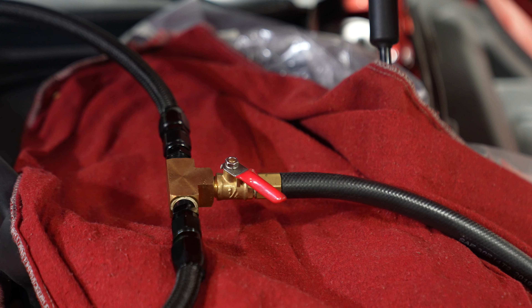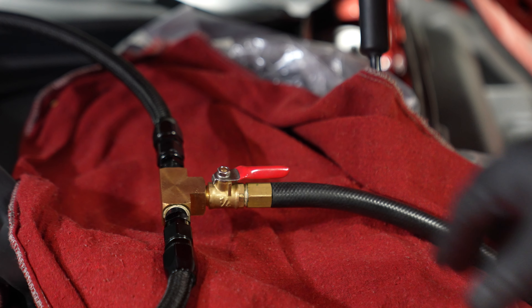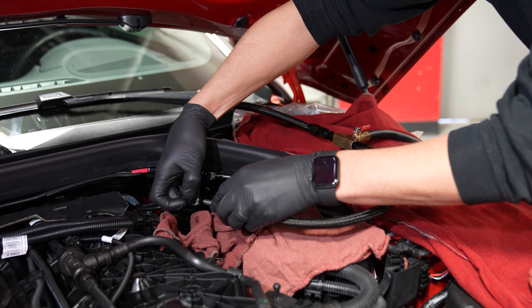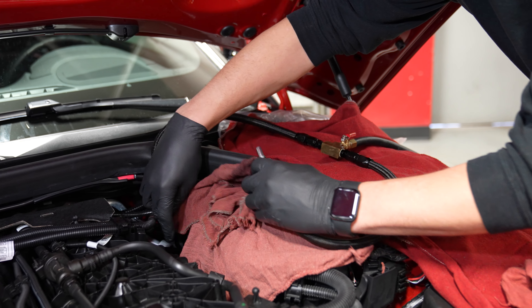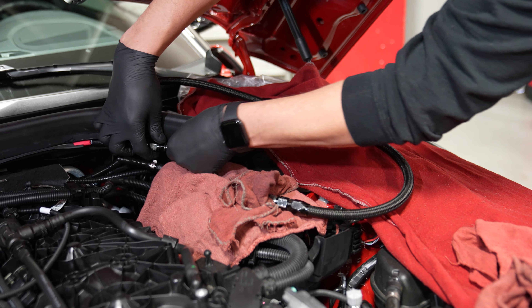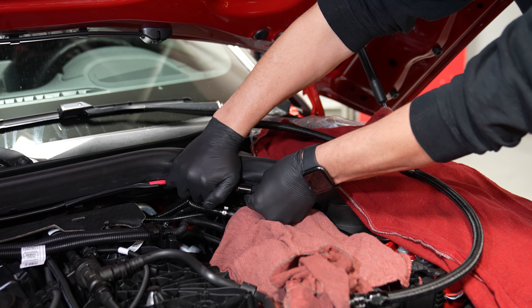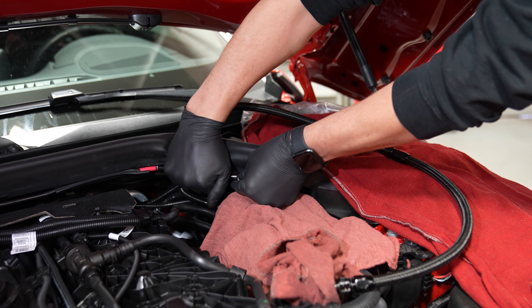With your fuel drained or sampled, you're now ready to remove the bleeder assembly. With the engine off, make sure the drain hose is still placed in the fuel container and go ahead and open the ball valve entirely. This will bleed off the pressure and allow for a pressure-free disconnection, but still be prepared for some fuel to come out. Reverse your steps and reconnect the OEM quick-connect fittings. For stock vehicles, make sure to replace the retainer clip and ensure that it's seated properly. I can't stress enough how much you do not want a quick-connect fitting to separate while the vehicle is running — your car could burn to the ground, so take this seriously.